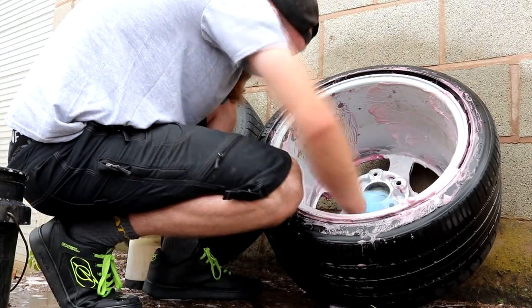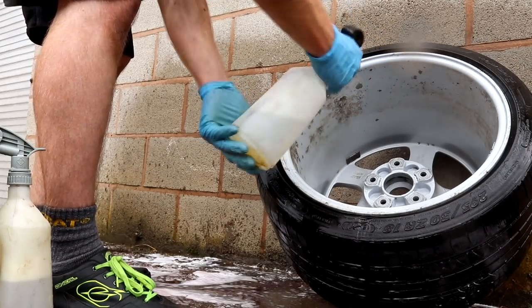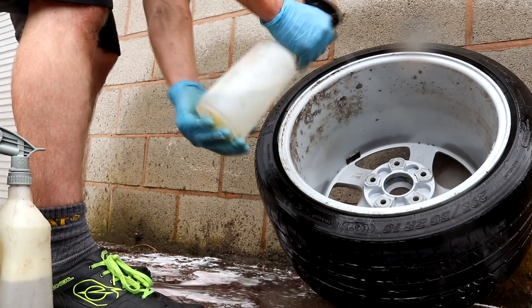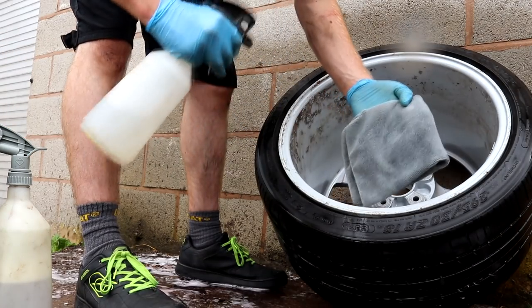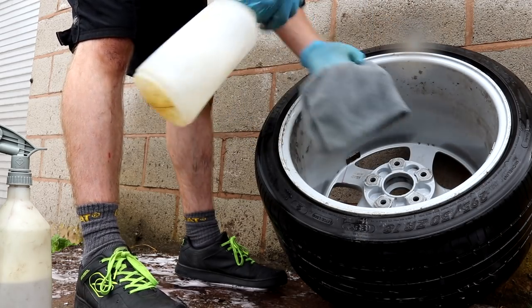With the primary contamination and concern for these wheels being the built up brake dust, I did complete the iron fallout process multiple times. I then followed with the tar and glue remover stage for a few separate hits to remove quite a few road tar deposits, not forgetting a few areas of glue residue from previous wheel weights.